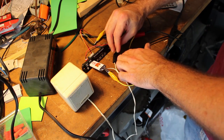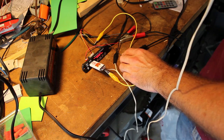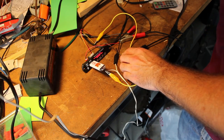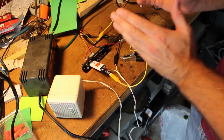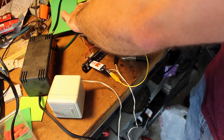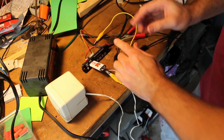I just need to connect the ground here — there we go. It came on and starts playing. It says USB and it says it's playing an MP3. Hopefully you can hear that. It is playing audio so we are good. This unit is working on 12 volts and we're getting output. Just to be sure I can check the other speaker by the other output — left output is working, now I'm checking the right. And it's playing. So we know the device works. Now I'm going to start connecting extension wires onto this.